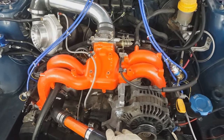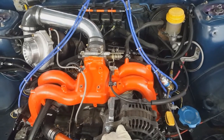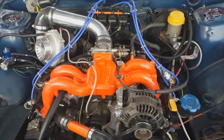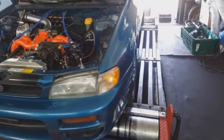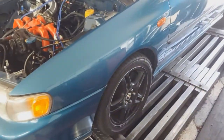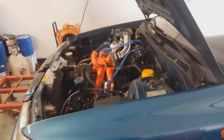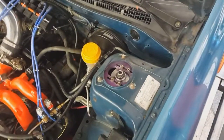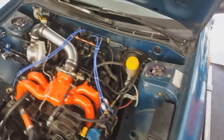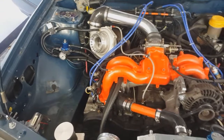Over time I'll probably switch to a 2.5 liter when this engine breaks — and I'm totally aware that's going to happen. Suspension-wise it has KYB AGX struts with Ground Control coilovers. I need to fix the front ones — the sleeve is too tall so there's basically no stroke and it bottoms out on any little bump. They have D2 pillow-ball top hats for camber adjustment.